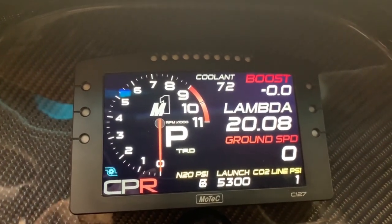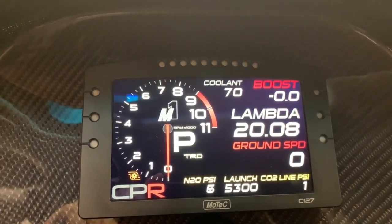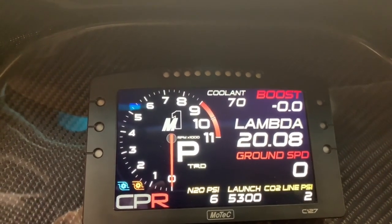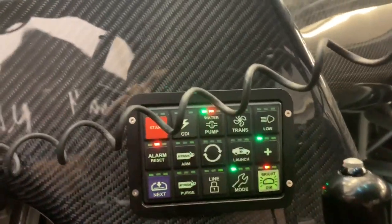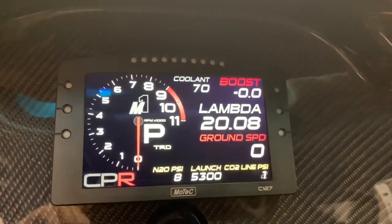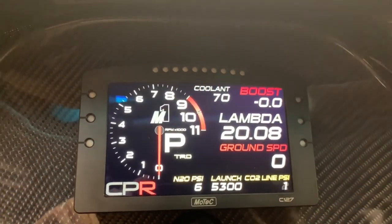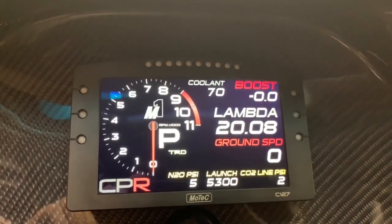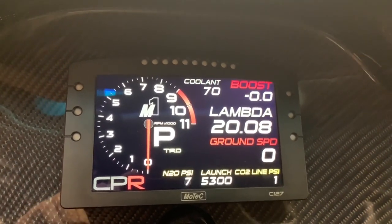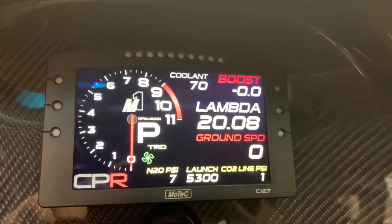I thought if I'm adding that, I might as well add something for the water pump — that comes on in blue — and then the intercooler pump is orange right next door to it, so when they're both on I'll see both indicators along with the lights. The lights on the dash will not turn on unless there is an actual amp draw, not just a status activation, so we know the pumps are actually running and flowing.